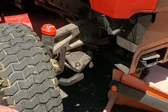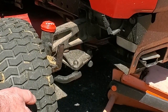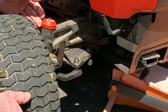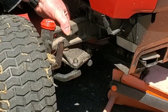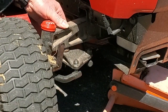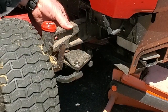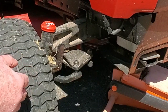What happens here is when you turn this wheel, all I'm doing is turning it like this, and the other wheel is not moving — you have all this play. Now, when you're going forward, this axle gets pushed back. You can see when that axle goes back, it's actually tilting back because it's on a pivot. So there's a little bit of play, it tilts back, and both wheels actually turn out a little bit.